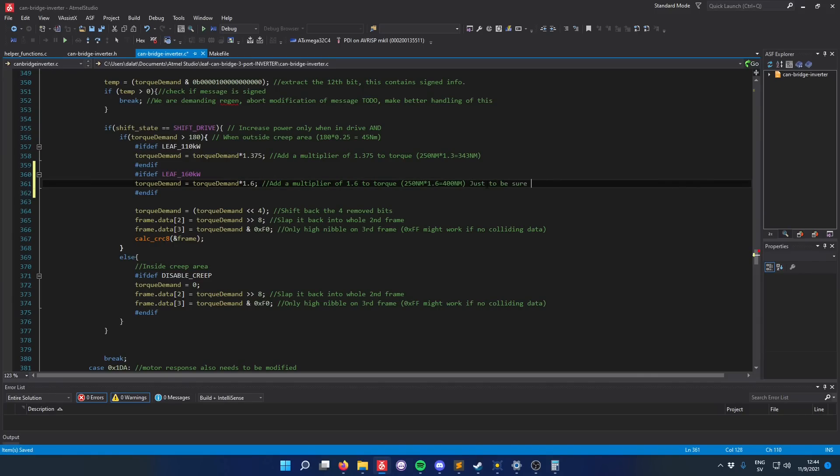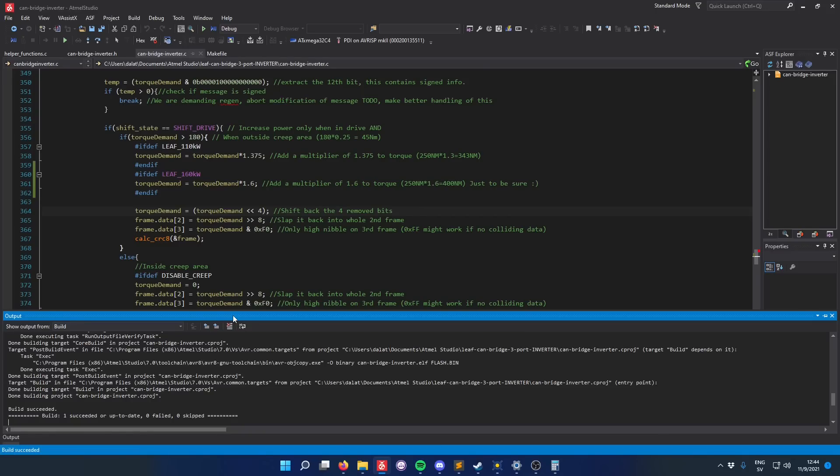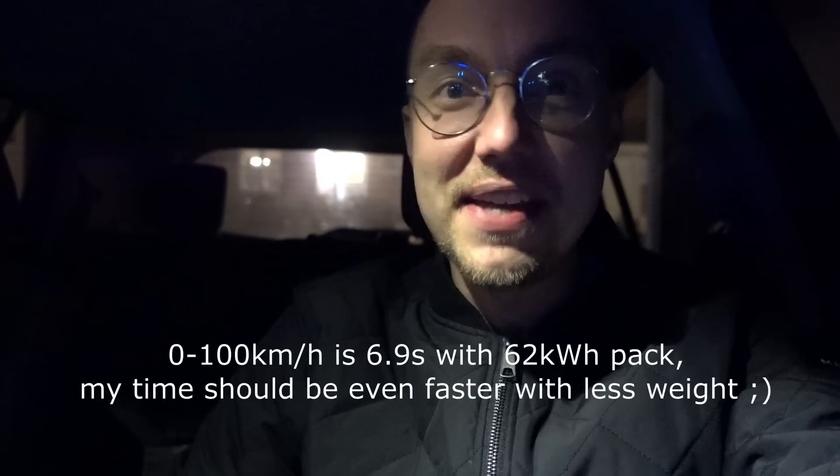Everything is good to go for a power test except the weather. Sorry about the camera quality — it's pitch dark in Finland right now. But I managed to do some road testing and I saw 140 kilowatts on the LeafSpy screen. I could barely get any traction; even with a rolling start it just wants to spin the tires like crazy. No glory shots this time, but maybe next video. I've also seen screenshots where if you push the inverter to the max on the e-Plus, you draw almost 180 kilowatts — so we'll take this as a long-term test and benchmark and I will report back.